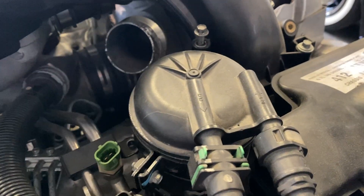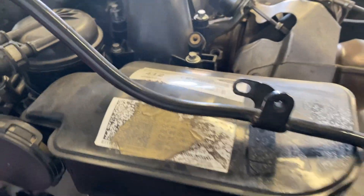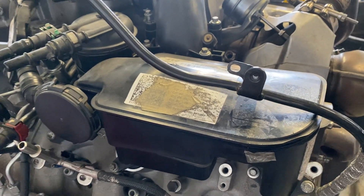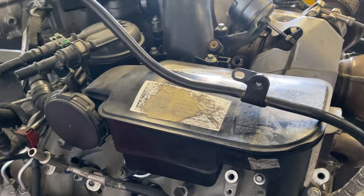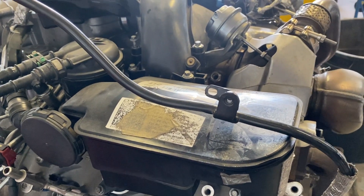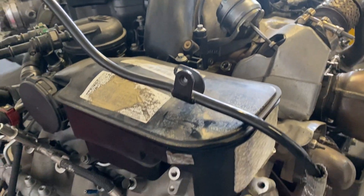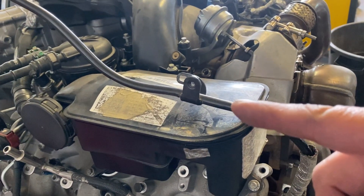For a quick tip: check your oil pan, check your bolts, make sure you've got a leak identified. If your truck is over 100,000 miles it is a wise idea to order one of these separator boxes. I tried to order one two weeks ago and they were on back order — you may want to inquire with your Ford dealer. Thanks for watching — we'll talk later about other stuff with the Power Stroke 6.7.